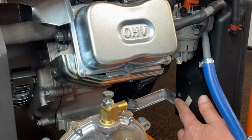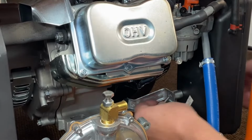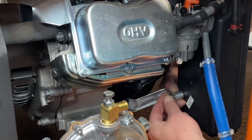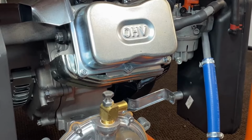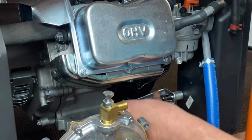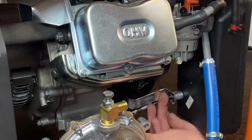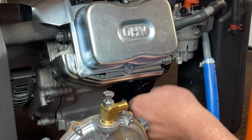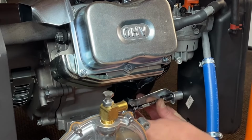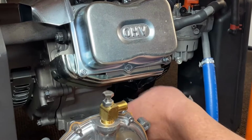And then when you put the adapter on, it pulls it away from your vibration bracket here. So we will give you a spacer here. Go ahead and get that in there. And we'll give you a longer bolt. Sometimes this can be stubborn. Okay, got that started. Let's go ahead and get that locked down. Alrighty, let's put that down. Alright, got that locked down in there.